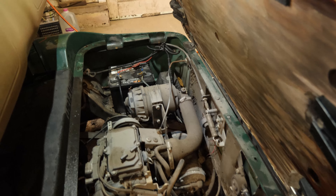We're going to do plus, minus. You can see the battery's actually dead. When I load it up, it drops down to zero volts. And you can see how it's climbing. So that is our first issue. The first thing we've got to do before we can do anything else on this cart is let it charge. For you it's going to be a few seconds; for me it's going to be a day.